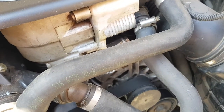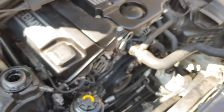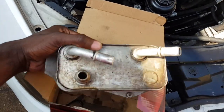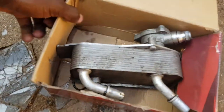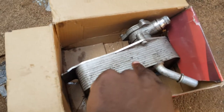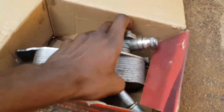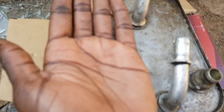You'll have to remove each one and do a test. This is the engine oil cooler I already removed, and this one is the transmission oil cooler. The way it works, it's separated inside — one side has the oil galleries and the other side has the transmission fluid and coolant galleries.